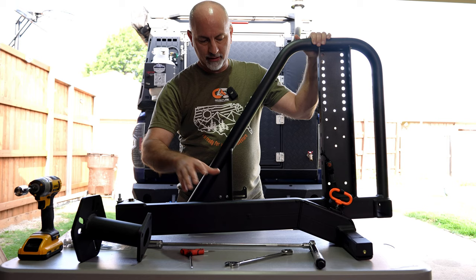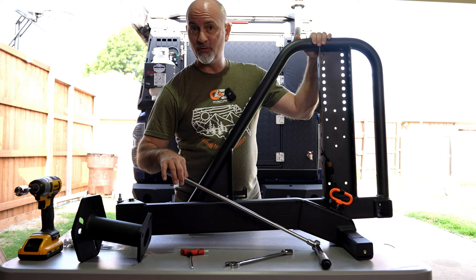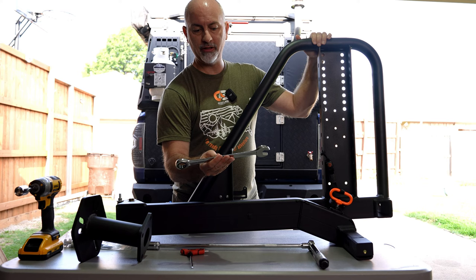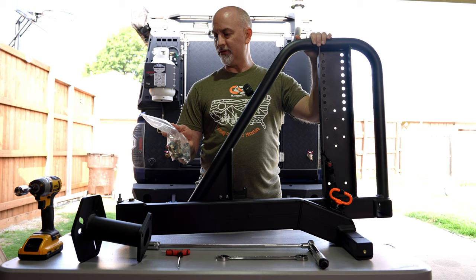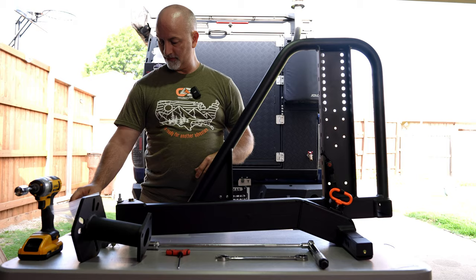The tools that you will need are a torque wrench that can go up to at least 100 pounds, an extension at least 12 inches — the only one I could find was 20 inches — and a 19mm or 3/4 inch socket, a 3/4 or 19mm wrench, and a 4 millimeter Allen wrench. This particular piece comes with all the bolts you'll need to bolt everything together and the lug nuts to put the wheel on. Just this unit right here costs a little over $1,600.